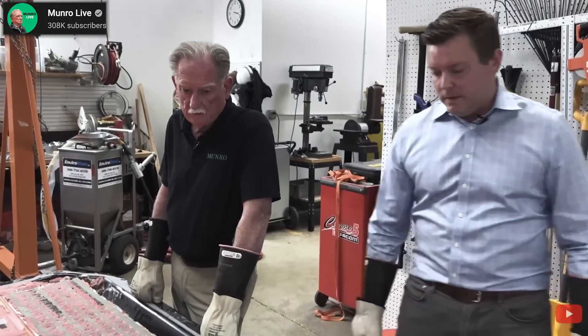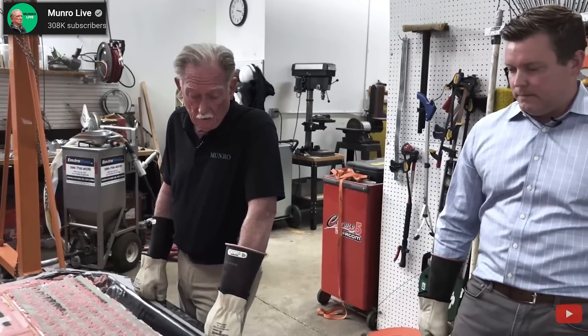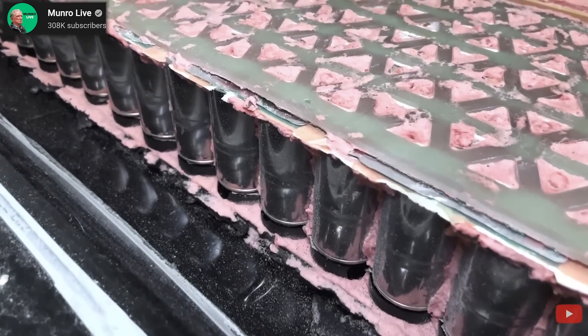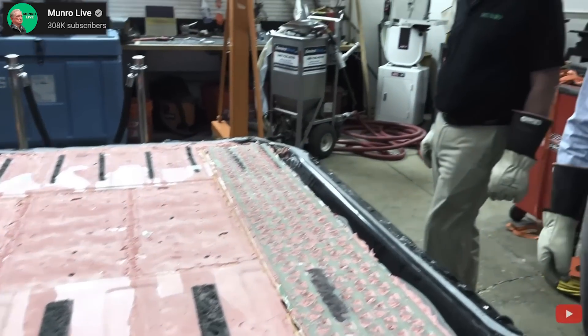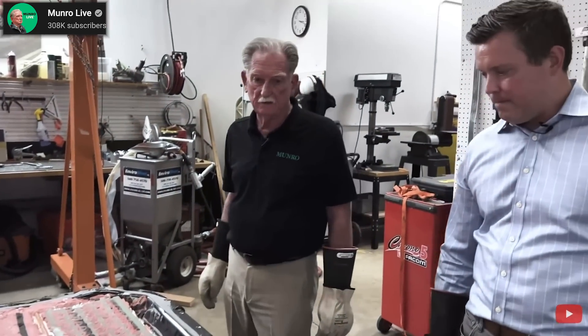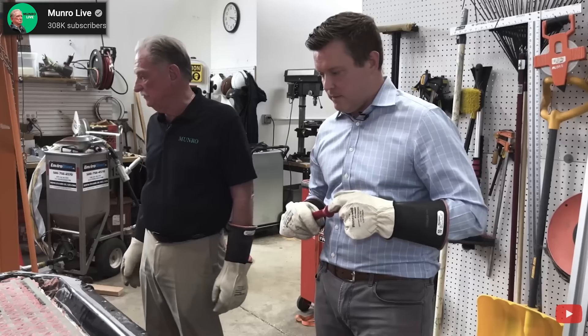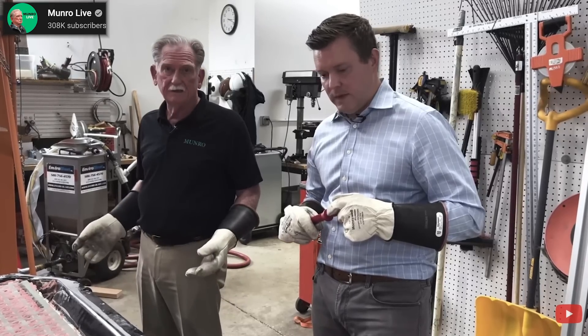Back to the four distinct modules in this structural pack — rather than all of the cells being in one big brick, the barriers in between may be a fiberglass-like material, which could be for thermal runaway mitigation. Sandy said this was cleverly done and thinks the chances of thermal issues with this pack may be less than the competition.